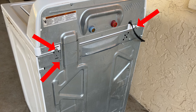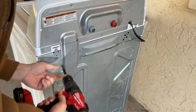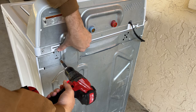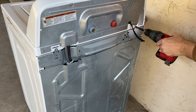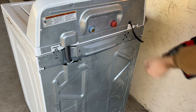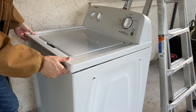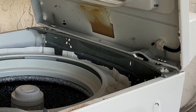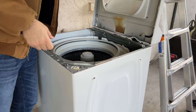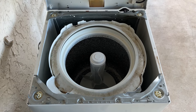To begin I remove these three screws on the back. One of the screws holds this metal panel in place — once the screw's out the panel just comes loose so you can set that aside. The other two screws hold the top of the washer in place. Once those screws are removed you should be able to slide the top of the washer towards the front and tilt the top back so you can see down inside of the machine. As a point of caution, it's not on hinges or anything so just make sure that the tabs line up with the grooves in the metal. I also sat my ladder back behind it so I would have something to rest the top up against.